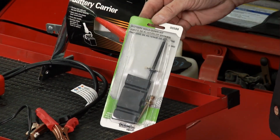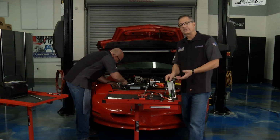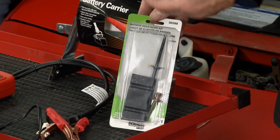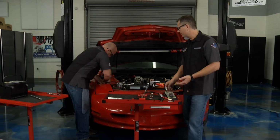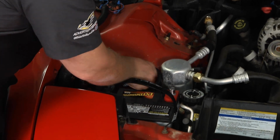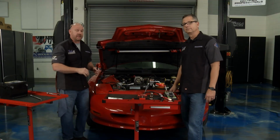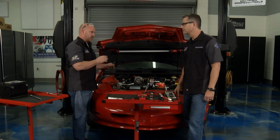Inside of there are plates. They're dissimilar metals doing a chemical reaction and they're flaking off, and eventually all that stuff's getting on the bottom. So if your battery's bumping around or slamming around on there, you're going to have a problem, man. It's going to start to short out the battery. That's hugely important. How's it coming over there, Brian? We're just about done. I'm going to tighten up that battery clamp. Also really, really important. A lot of people overlook getting that clamp hold down tight. The battery's going to vibrate and fail earlier than it's designed to. Make sure you get that right.